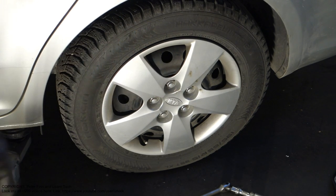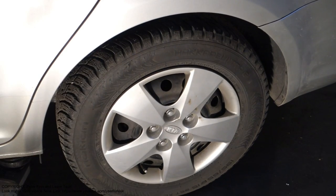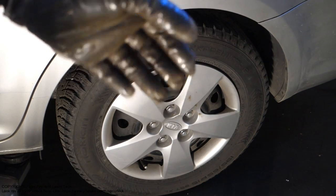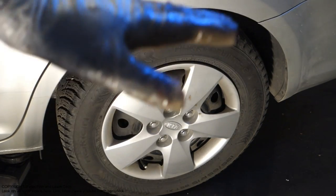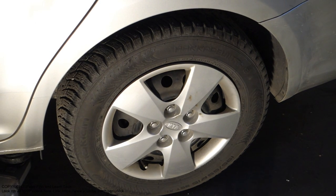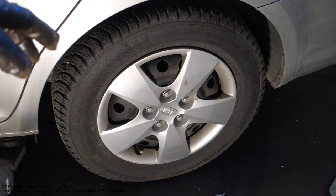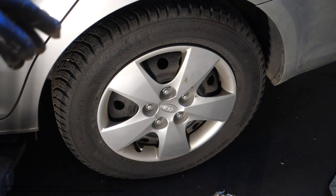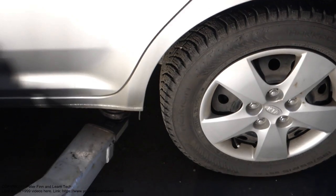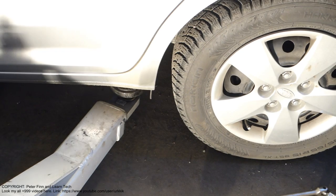We don't take those bolts away, because the next step is that we need to lift up the car body, so that the wheel moves freely in the air. And remember, when we work with these car repair jobs, they are dangerous, so we always need to install some support stands like in here. This is a support that keeps the car body up.